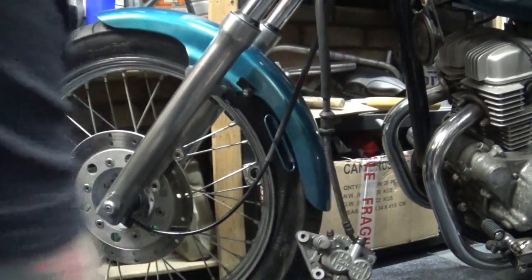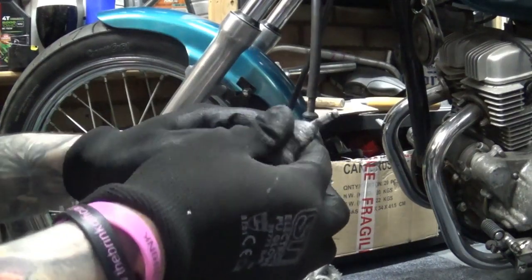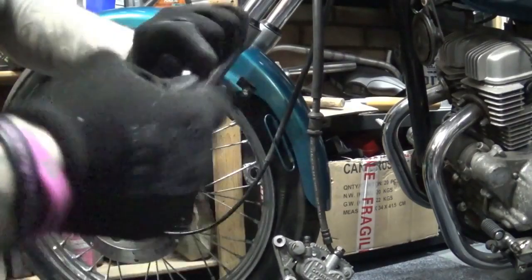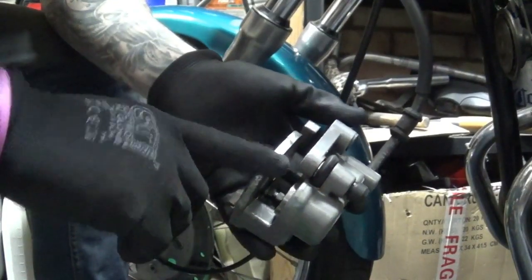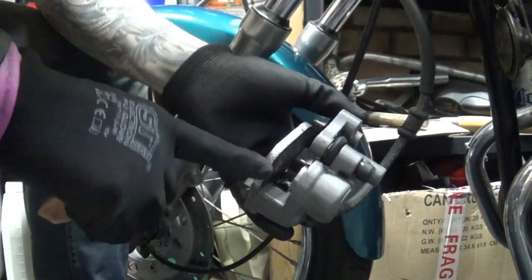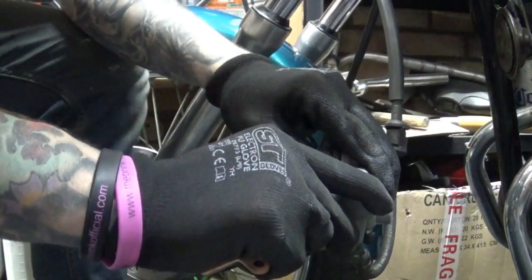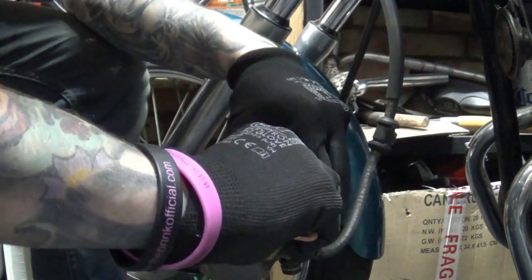And once we're on a cleaning spree, why don't we give some love to those sliding pins? A little bit of steel wool should do the job just fine. Magic. Now it's all lovely and clean, we can install our brand new brake pads inside the brake caliper. What we need to do first, most likely, is push those pistons back. There are various ways of doing it. Brute force is usually the one way of dealing with it. Slowly and gently they will eventually go back in there. Very slowly and very gently.